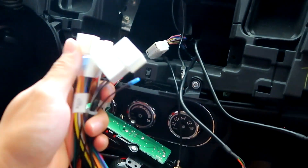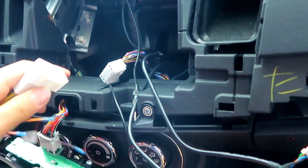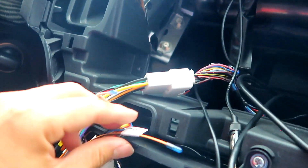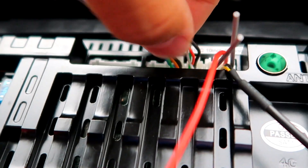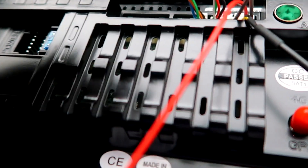First things first, I'm going to hook up the factory harness — this is what's providing power when you switch it on. Just find the one that matches in size and clip it on. You might notice you have a bunch of other connectors here. This black one goes to power, which connects to the port on the head unit that says power. There are more little dongles — just so much stuff you can connect. Everything is a different slot and different size, so it's straightforward which one goes where and you won't really mess it up.